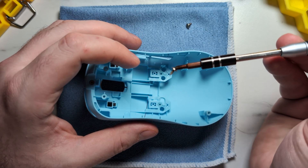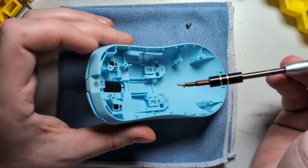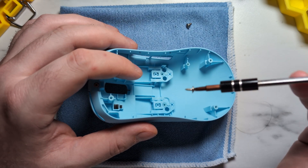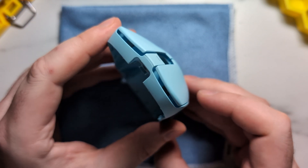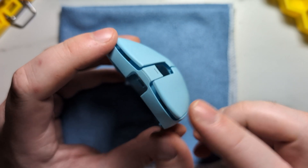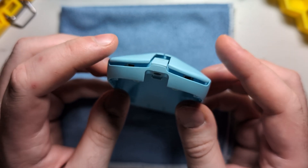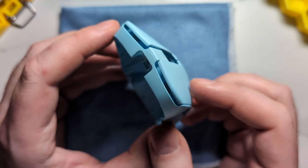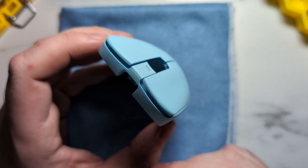Put the anchoring screws in while resting the shell on the base part — don't place it so pressure pushes the clicks out of their anchoring spot. Make sure you don't over-tighten or under-tighten the anchoring screws: if over-tightened you will break your main clicks, and if under-tightened the clicks will be very sloppy. Screw them in until you feel a little bit of feedback — do not over-tighten. Flip the unit up to verify — the clicks should have a natural buoyancy. If over-tightened, the click won't go down; if under-tightened, they'll sit too low.